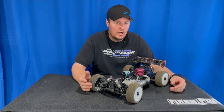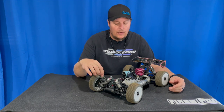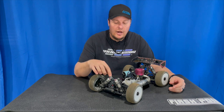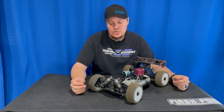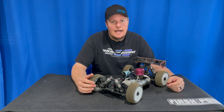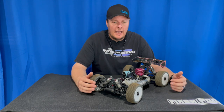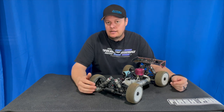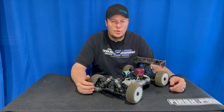The simplest way to look at it: longer is calmer and smoother, shorter is more aggressive and sharper. You can compound that by playing with the amount of camber via the number of washers, and also playing with the height — watch my other video on upper front arm height and combine those theories. There's a lot going on, so get out and test at the track. If the front end feels too aggressive, go longer; if it feels too numb, go shorter with the upper front arm position.